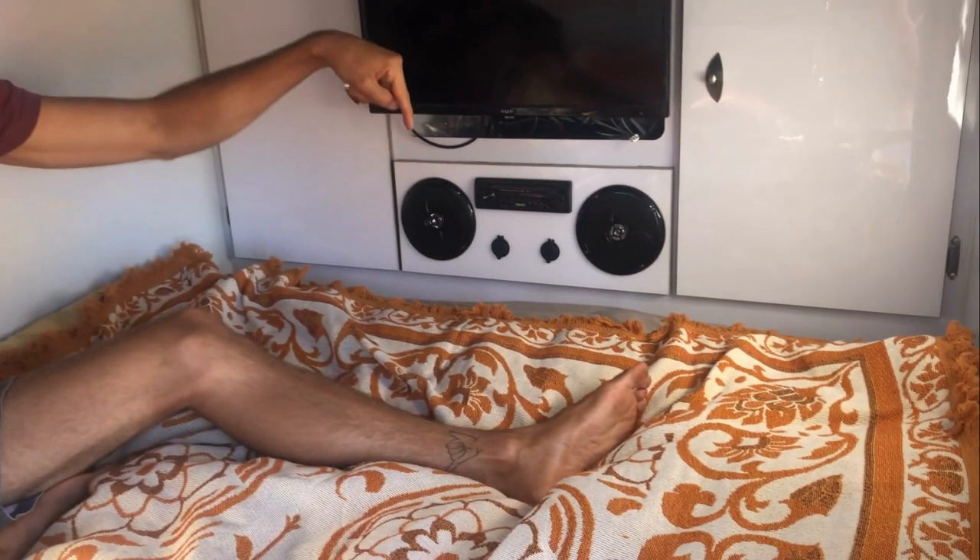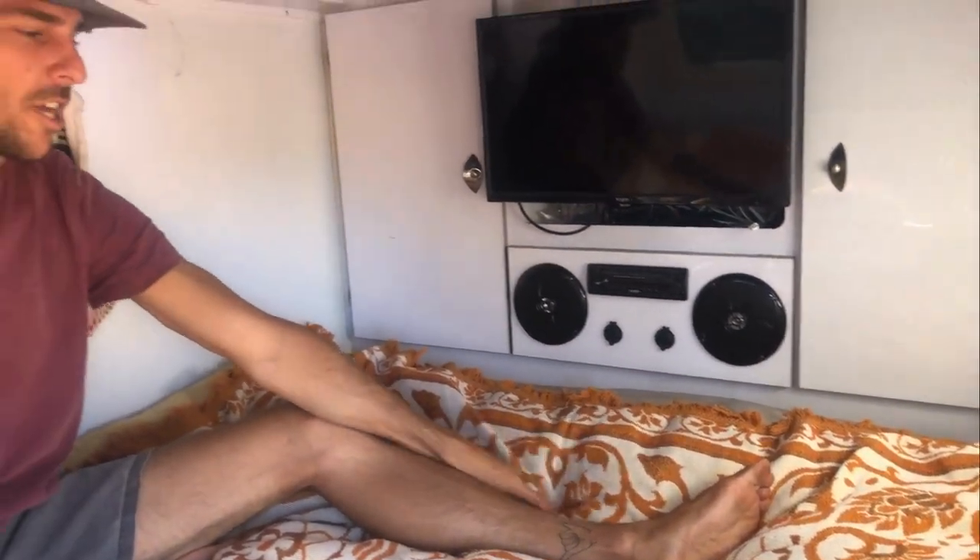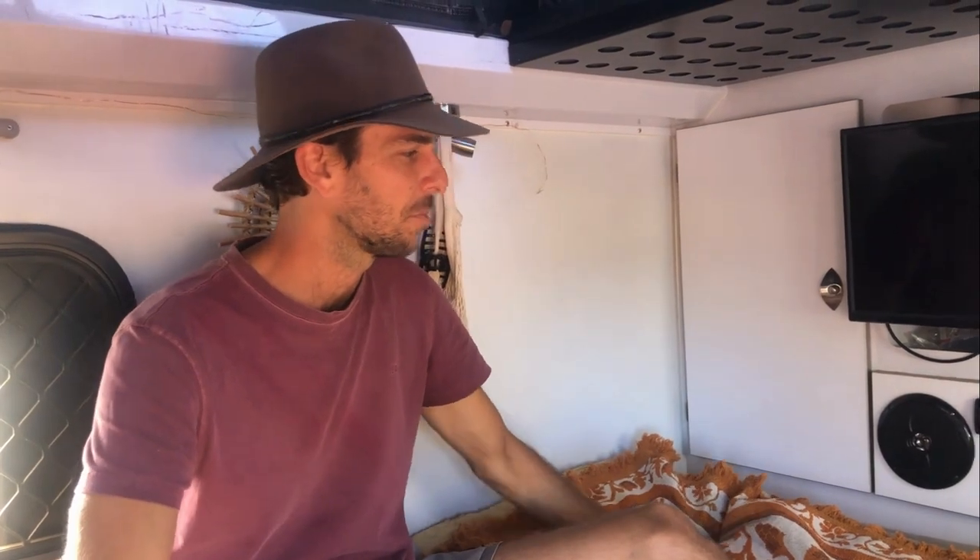Also underneath the chairs in here, this side we have the AC/DC 240 volt charger and the solar charger from the panels on the roof to charge the batteries, and we have the 2000 watt inverter in here as well. On this side at the front where we sleep with our heads, we have 320 amp hour AGM deep cycle batteries, and the other side is just storage — we keep a lot of spare food in there. When we're going free camping for a while we can go to Coles and stock up.